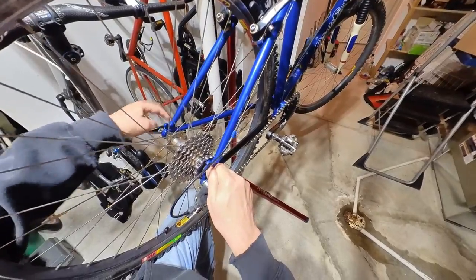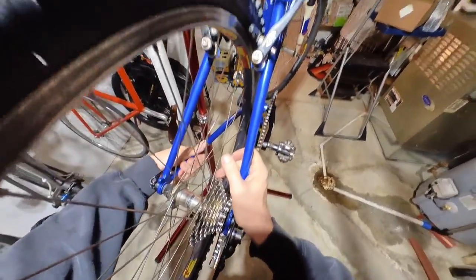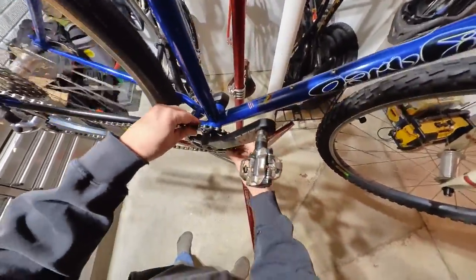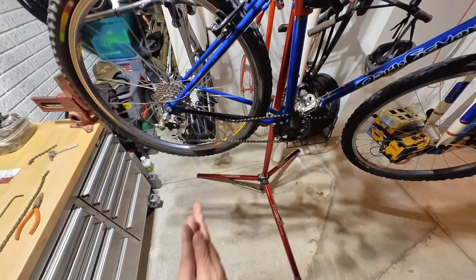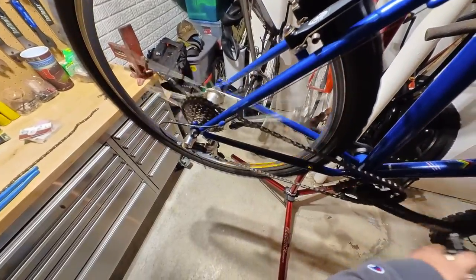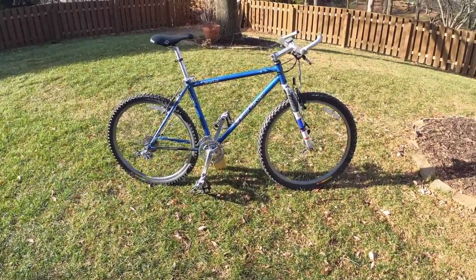Let's go ahead and install the rear wheel and test the drivetrain out. Let me know when you spot my fault. Let's go ahead and crank it for the first time — and oh crap, the chain fell off. Try it one more time. Maybe if I switch gears it'll work better. Oh, chain fell off again. I'm cleaning my hands and it was at this moment that I saw my error. Now that I've corrected my error, everything seems to be shifting normally. The problem was I routed the chain incorrectly — I routed it underneath the chain stay instead of over.